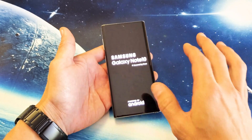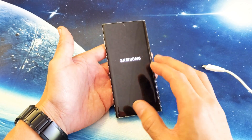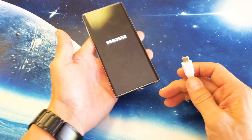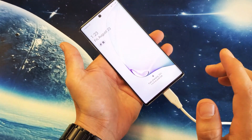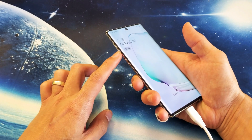Now, if it's still not working, give this a try two or three, four, five times. If the force restart doesn't work, the next thing you want to do is go ahead and plug in your phone and give it power. Let it start charging. Wait about five minutes. After five minutes, you want to do the same thing — volume down, power button.